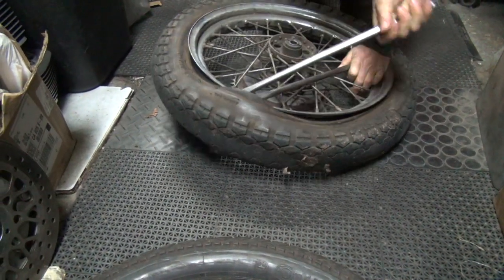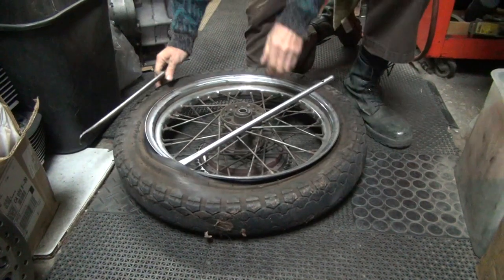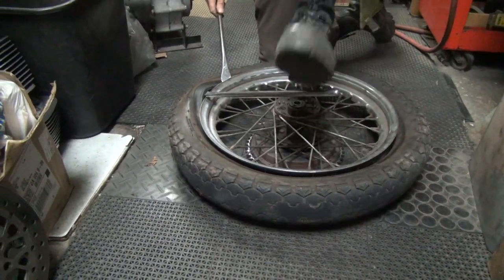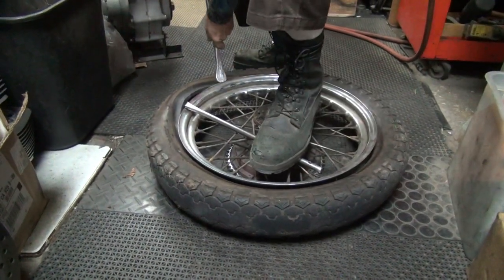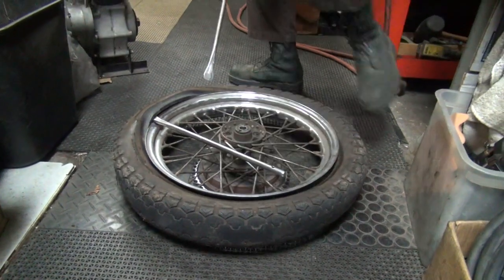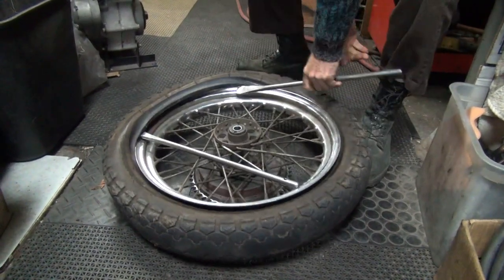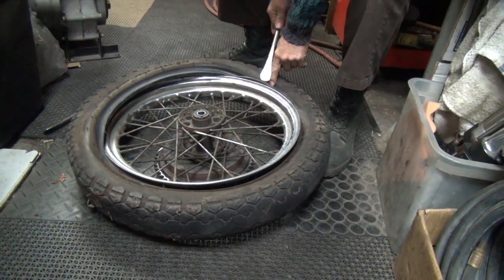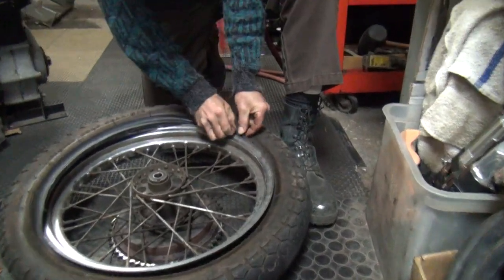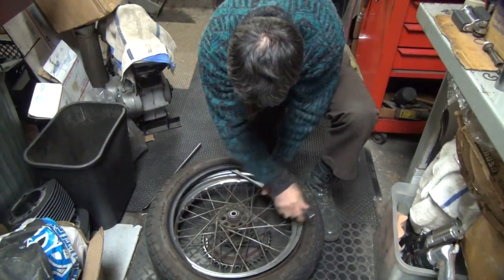Hey, careful of the rim, dude. That's brand new chrome — you want it done correctly. See how I got a Dunlop tire on now? It works on the Dunlop tire — they're compatible parts. That's a Harley rim now. I saw a high shoulder back there. That's what you get on the back of this bike — it's a mid-shoulder. A halfway high shoulder. There's your tube — my tube was coming out. There's your problem, there's your lack of air. That's some separation issues right there. You go like this and get a tube right there like that — it's not good for the tube either. We're not going to use that tube anymore.